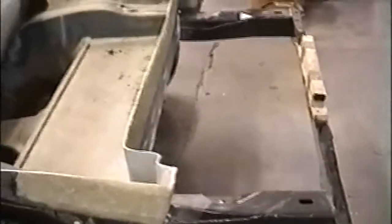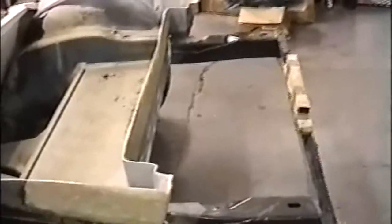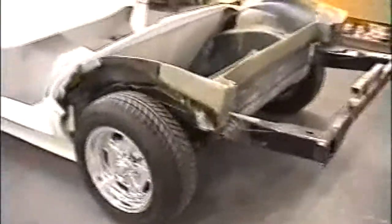The fuel tank is going to go in the rear here. Once we've shortened the frame, we're going to measure up for that, and I think we're going to use a 1932 Ford fuel tank — that seems to be the one that follows the shape of the rear deck the nicest. This is our rear clam, mounted upside down. We've just been cutting the holes for rear lights — three either side and then the licence plate light. Stock Corvette ones with slightly modified housings — going in there looking good.